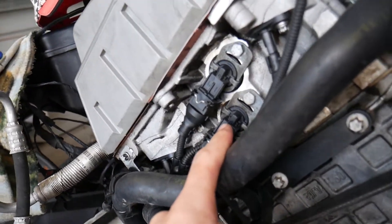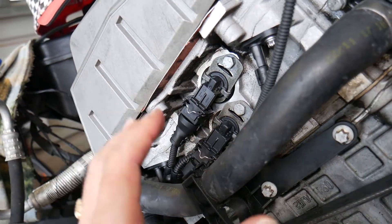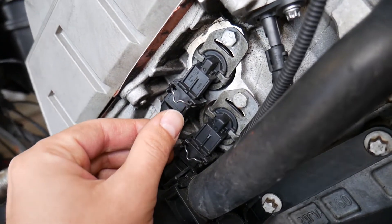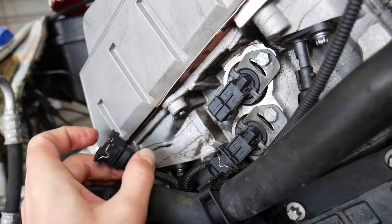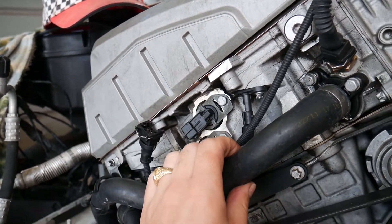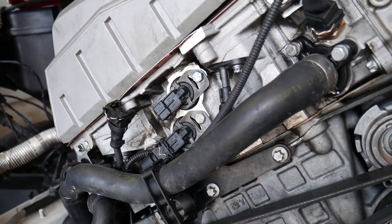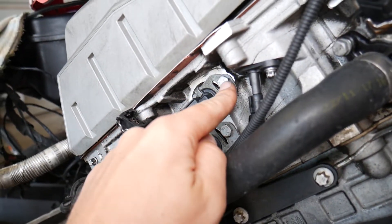You may not even need your solenoids — we'll explain that in just a second. The removal procedure is exactly the same for both; it doesn't matter if you remove the intake or the exhaust. What you need to do is press that metal piece down and at the same time pull the cable out. Then clean everything really well, because you don't want to contaminate your engine with dust, dirt, or debris — if anything falls in, it can cause damage. Now we need to find a 10-millimeter socket to fit here.